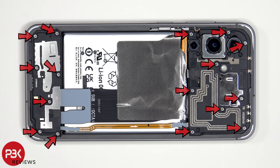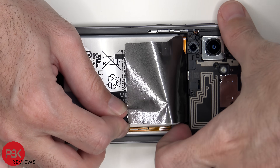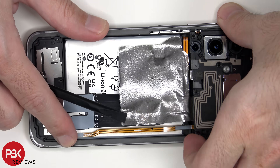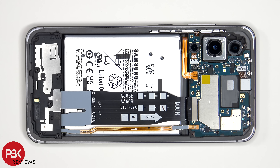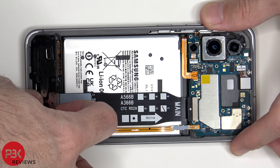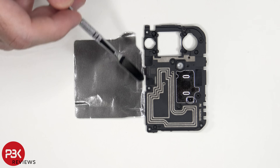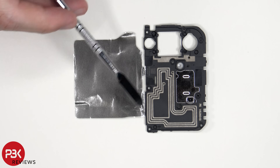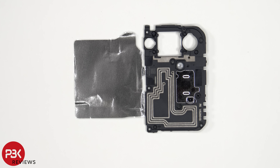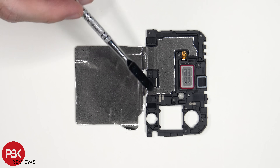At this point there are 16 Phillips screws which need to be removed. Looking at the top plastic cover, we see an antenna line drawn which is a light gray color line, the NFC antenna, as well as graphite film to help transfer heat. We can see the earpiece speaker located on the other side, as well as the graphite film extending underneath.